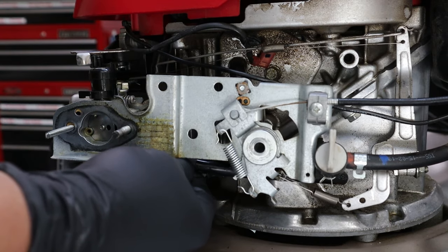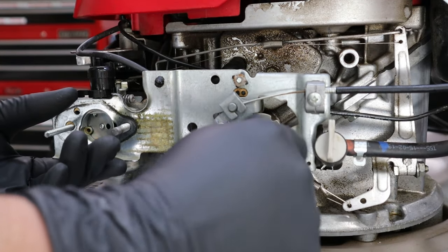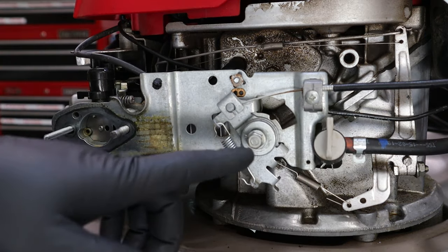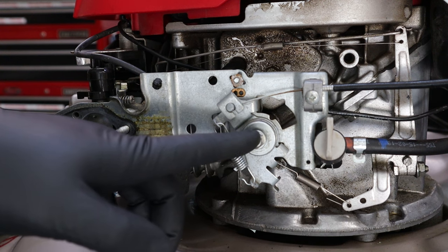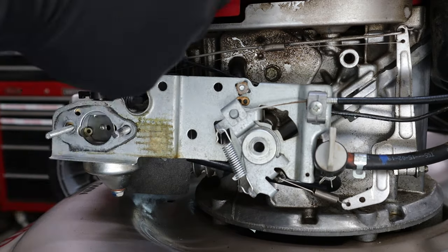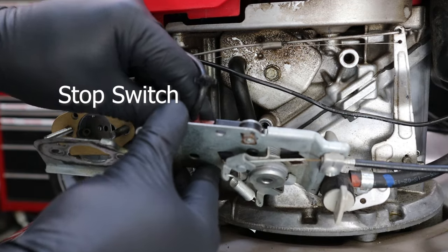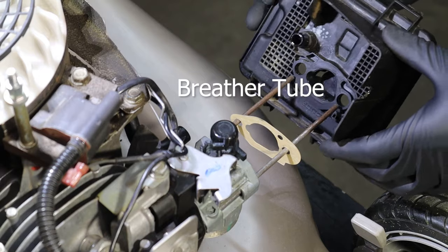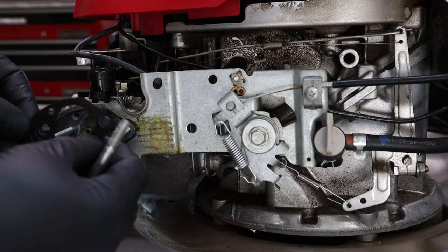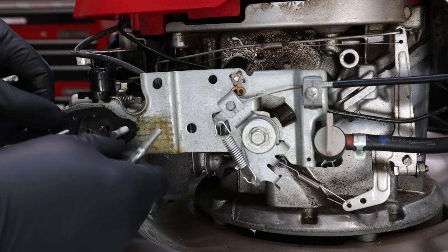Go ahead and reinstall the carburetor metal plate assembly. A little pro tip: when you install the plate assembly, leave this bolt loose — this holds on the plate assembly as a whole, so don't tighten it down to the very end, leave it just a little bit loose. Key notes: you need to make sure you have the fuel valve hooked up, the stop switch hooked up, and the breather tube hooked up — that should be the only things involved in this assembly. Keep in mind the breather tube is located on the back of the air filter box. And yes, we have come to the last gasket: the carburetor gasket on the opposite side of the metal plate assembly.